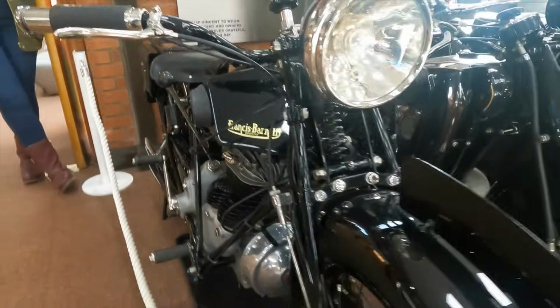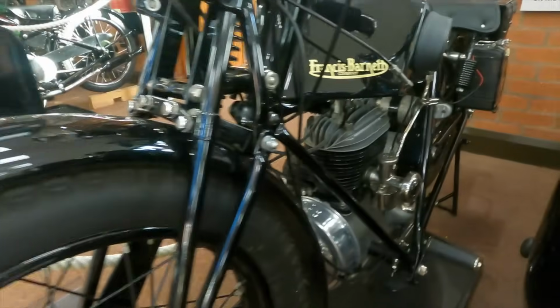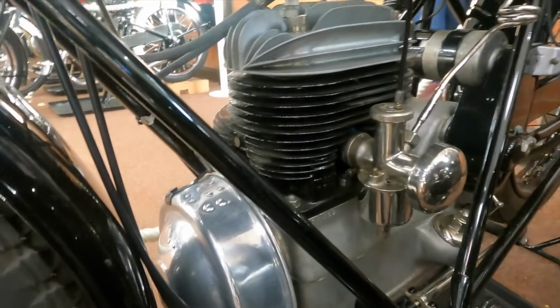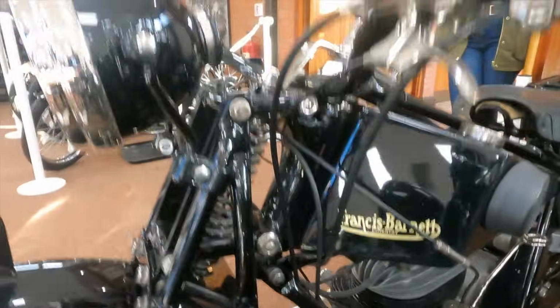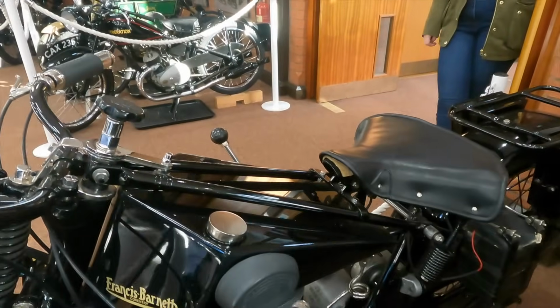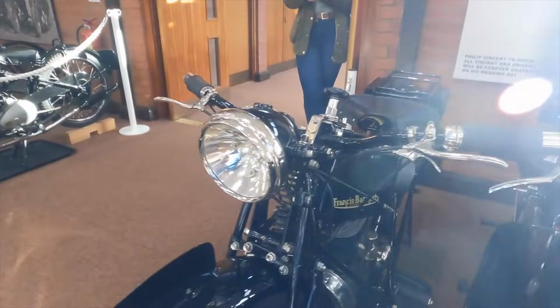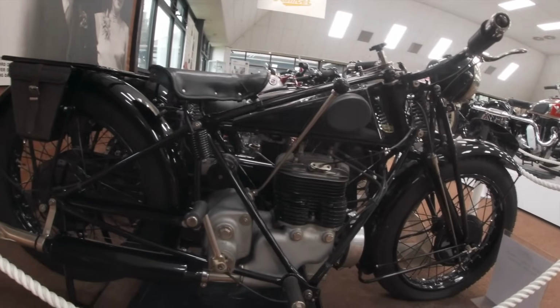The bike was never intended as a sports machine employing just a single carburettor, and was praised for its smoothness on release. Top speed, incidentally, was around 95 kilometers an hour. That's around 55 miles an hour for a 127 kilo bike, so despite its bulky looks, it was actually surprisingly light. At the top end, the engine had cast iron barrels with a single piece aluminium head. Inside could be found deflector pistons constructed of aluminium.